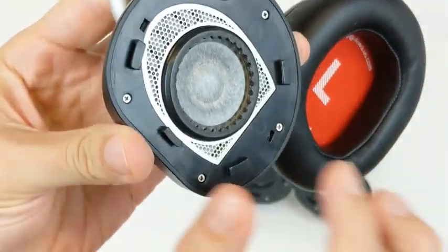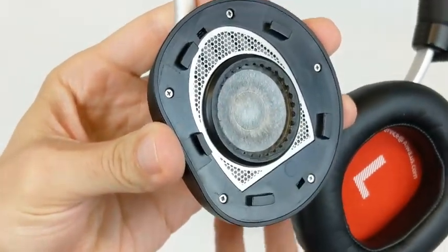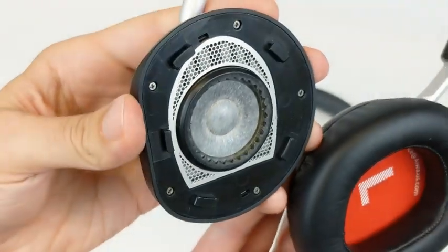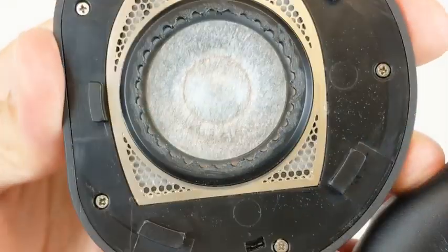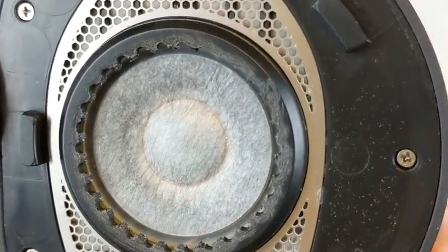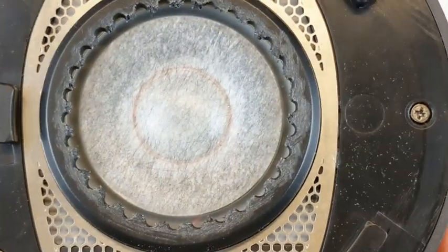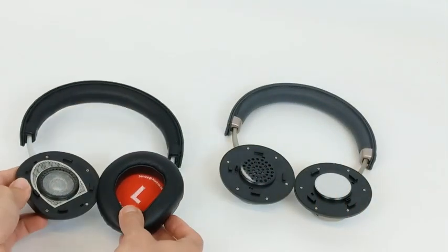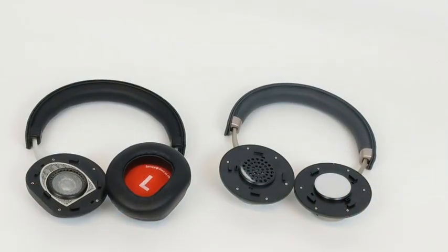Here's another pair of Arc 1's that's had the grill removed during acoustic testing, so you can see the driver more clearly. If you look closely, you can see it consists of the cone and surround — two parts. This is what makes it different from the single part diaphragm commonly used in dynamic headphones. The surround is made of a thin, elastic polymer. It's very flexible, and it really improves the low frequency response. The middle part is a super thin, but stiff, and lightweight composite cone with reinforced center dome. Compared to Mylar, this dramatically reduces breakup distortion, which gets you smooth and natural mid and high frequencies.